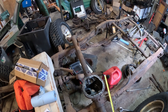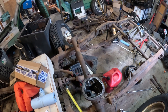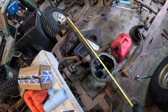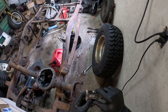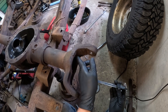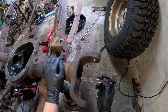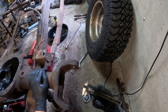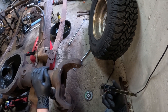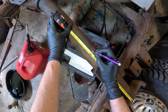This Dana 44 is probably overkill for what we're going to be doing, but it was the right price. There are a lot of good deals running for 4th of July right now for Dana 44 parts — believe it or not, this is cheaper than going for a Dana 30. Let's go for a quick look. That is 49 and a quarter. Something to consider is that the tube isn't quite the knuckle-to-knuckle measurement we took — there's a little lip on it. This is definitely something where you want to measure thrice and cut once. It's going to take a foot, just about right where the inside of that line was anyway.